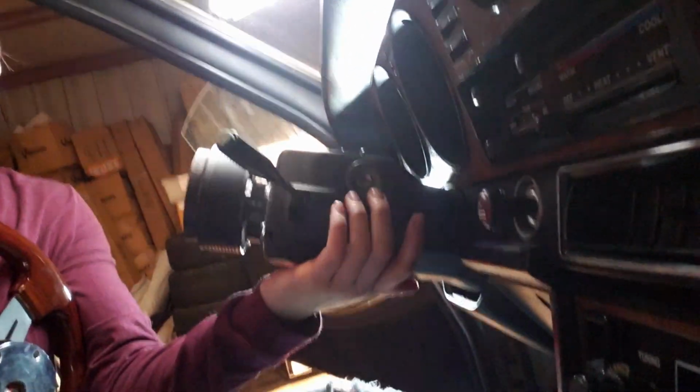Well, I got the hub on there, I got the lock cylinder back in, all of the surround is back on, but now that that's on there and I put the steering wheel up against it, it's kind of a little too much in my face, so the hub is a little too long. I don't know that they even sell a shorter hub for the Celica, so for now I'm just going to take the quick release stuff off of there and just run the steering wheel straight onto the hub. Hopefully at some point I can figure out a better solution.